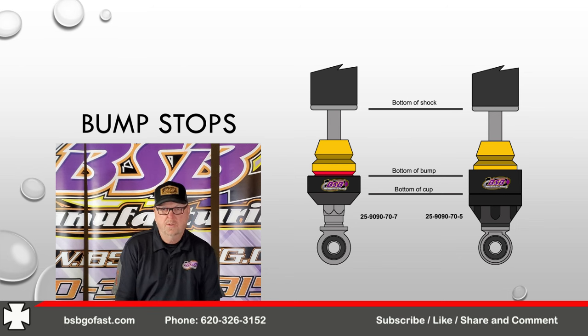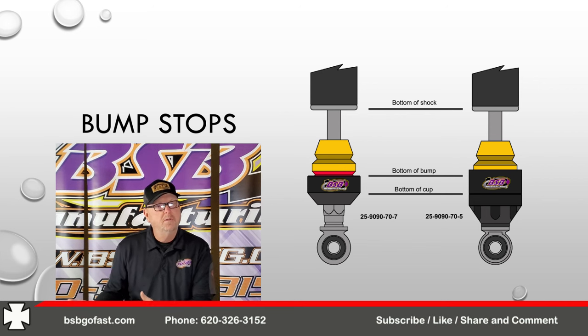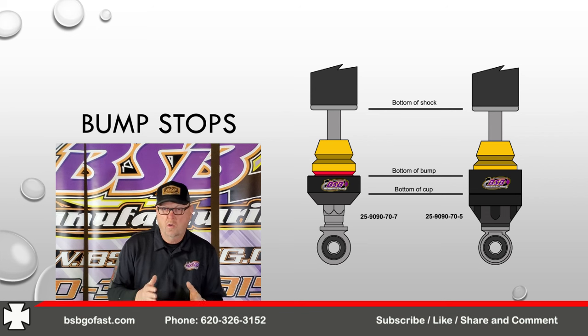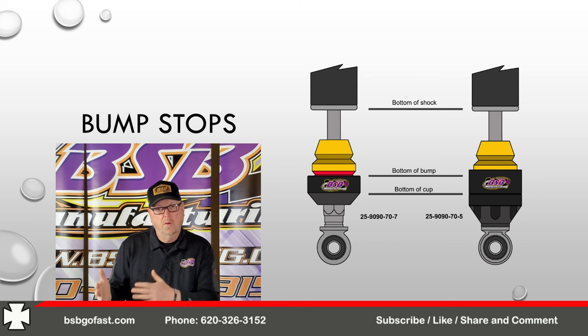On our first chart we're going to talk about bottom of the bump. How do we get a bump stop set? It's very difficult because we have to understand the load the bump is going to make. I'll show you a chart in a minute that will show us the load that the bump is going to make. A foam bump stop is basically a spring — a very progressive spring. It all comes in very late in the travel, so it's very small at first then ramps up a bunch. You can see some of the graphs on our website.